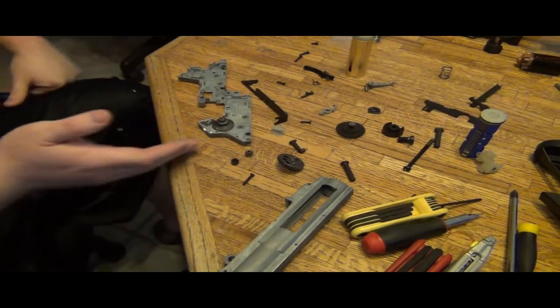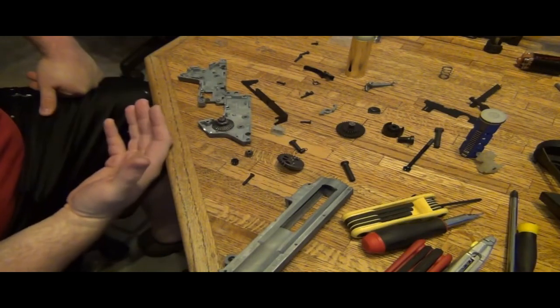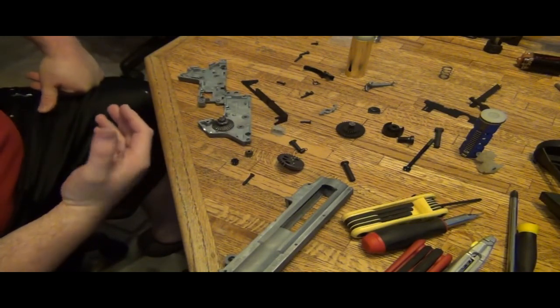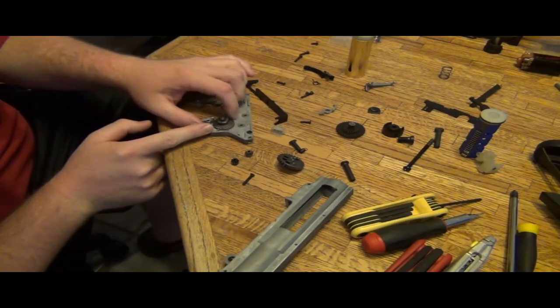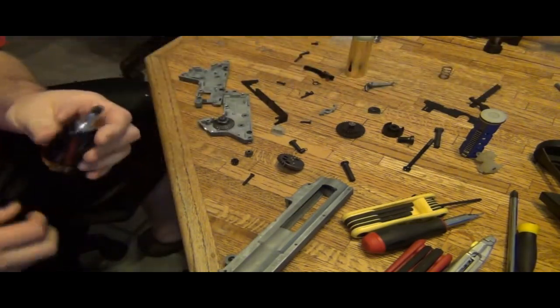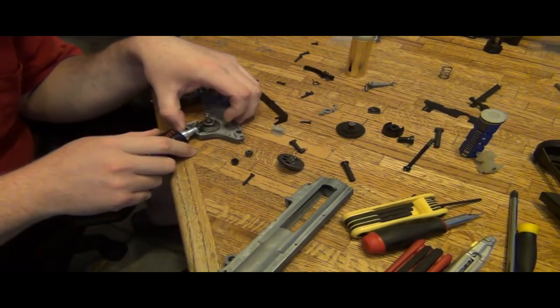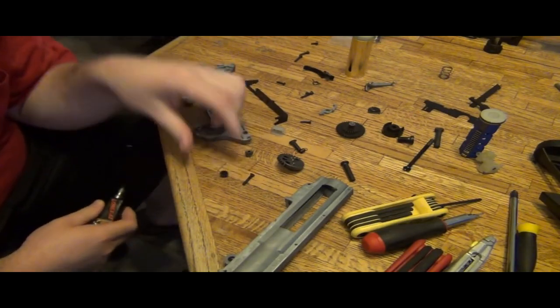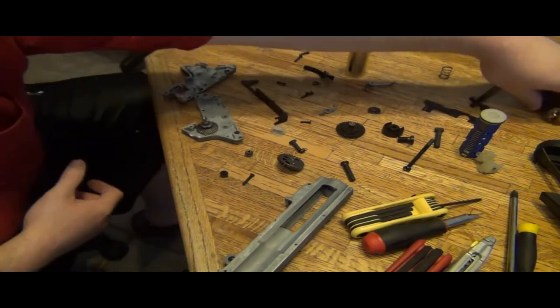We have the opposite. What I'm not used to is it's not close enough at all. It's too far away. So this is definitely not going to be any good for rotational spin and noise, and definitely not going to be good for the pinion. I can tell you right now, if I was to rerun this, it would more than likely look like this at some point. I mean, the amount of play is unreal. You can see that.